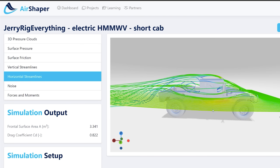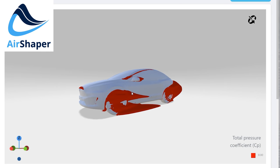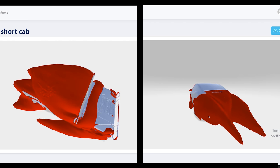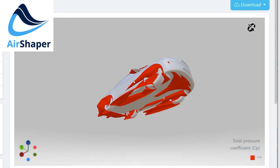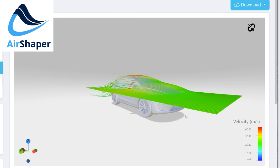The sharp angles and flat panels perpendicular to the wind create more turbulent air patterns, slowing us down at high speeds. The Tesla Model X has a drag coefficient of 0.24 — far better than the average car — meaning wind resistance has a much lower effect at high speeds. If we consider wind factor alone at highway speeds, my Hummer will use 3 times more energy and get 3 times less range than the Model X purely because of its shape. There's no drag coming from underneath or as much from the wheels on the Model X.